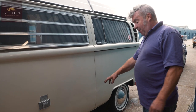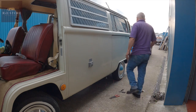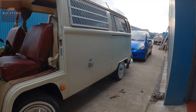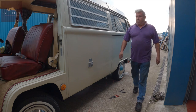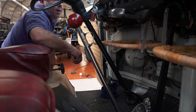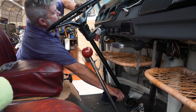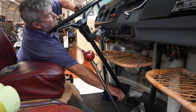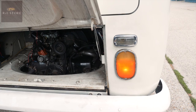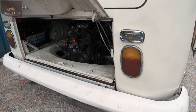Right, join that one there where we found the chafe in the wire, just reconnect that back up, test it all again — then we know that was definitely the problem. That's all now reconnected. Ignition on, brakes on — nothing blown there. Can you just check that the brake lights are on, Stuart? Yep, off — on, on, okay.